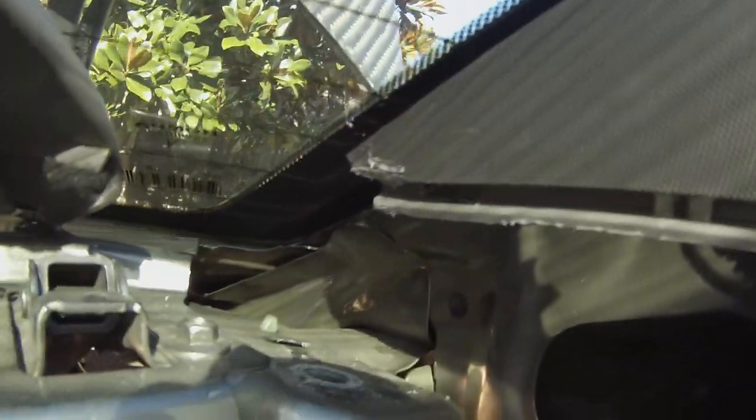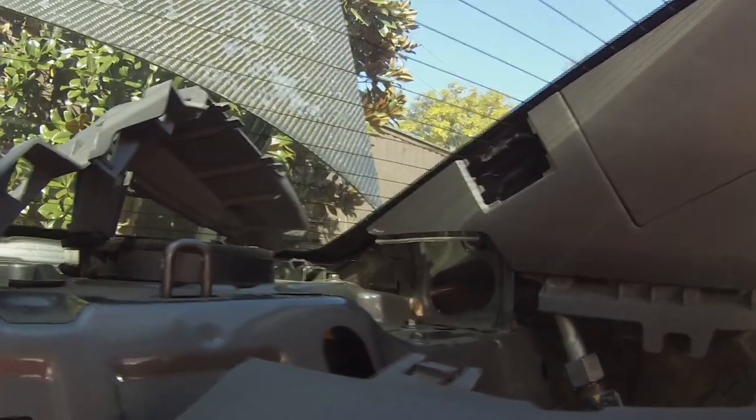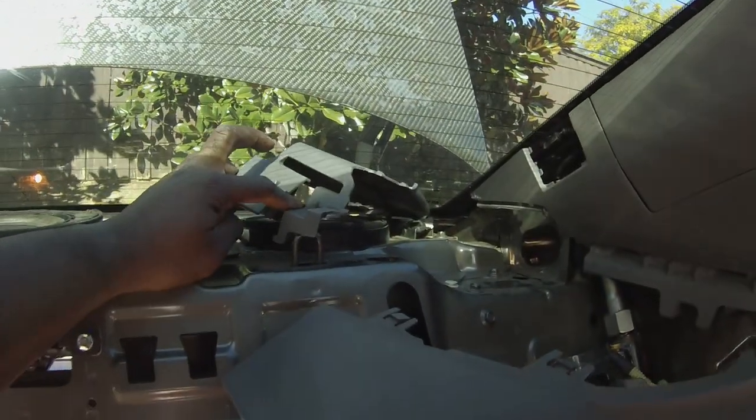There's really no way to avoid damaging the side a little bit. Again, you're not going to see that because that's way in the corner and you have everything on top of it. But the bolt hole is right there. It's so tight, unless you have a swivel, there's really not any way around it. No big deal, at least it's in the corner and that's going to go over it anyway. So we've got two out. This one's completely free. Now that one you just slip out of there. Don't forget, when you put the middle one back in, you've got to slip the belt through here too.